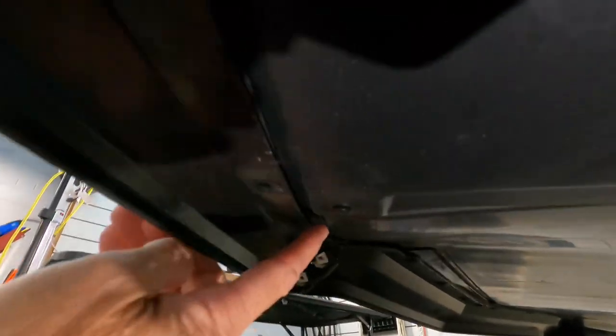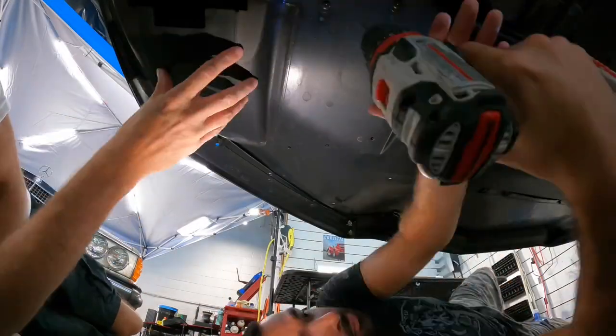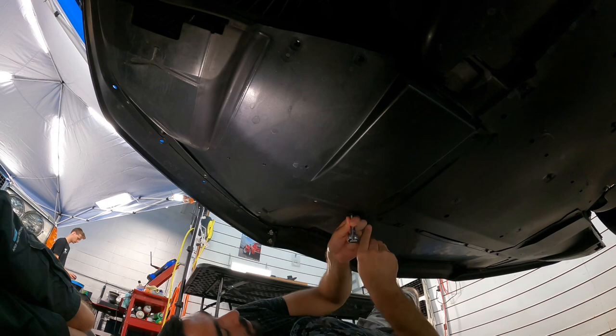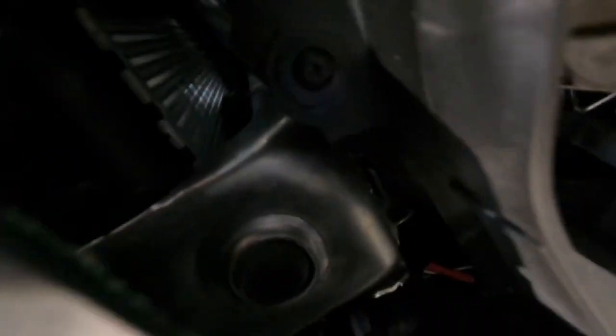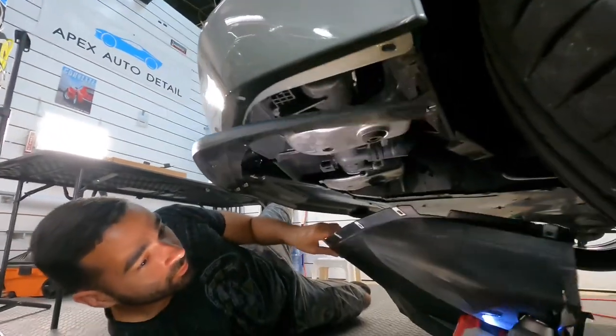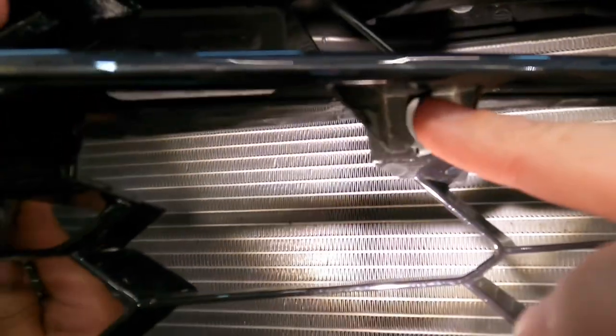You will find you don't have to remove the whole thing — just loosen it up so it can dangle, and you can remove a partial piece of plastic with a skid plate or the splash pan. That is held on by more T15 screws and one 7mm bolt. Don't pull down too hard. There is one hidden up in the recess of the pan itself, and that is where the extension comes in. Remove that and it will slide away from the front splitter and front bumper, giving you access from underneath up into this area.